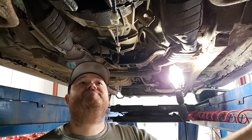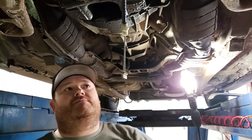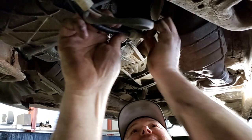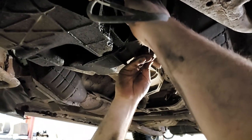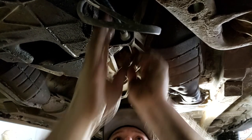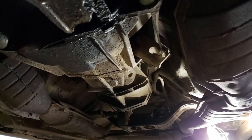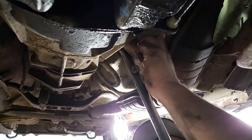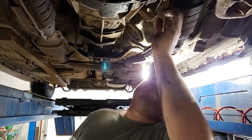We're underneath on the home stretch — first go, made it, it fit, it worked. Cut off the dangling zip-tie end. We use a pry bar to compress the fork and hook the cable end onto the clutch fork, get our retaining clip back in place, and we're done underneath. Topside for adjustment.